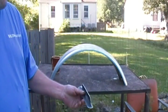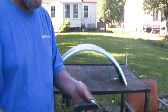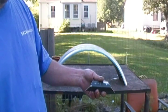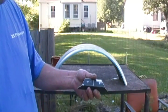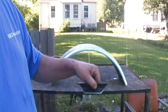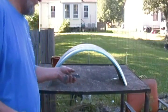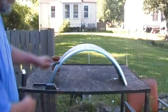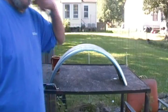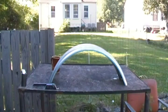This bracket will go down at the bottom of the frame with holes drilled in it to bolt to the fender. This little one will go up on the frame where the seat springs are attached — it'll hang off the bottom and hang down like that with bolts going through it. I'll drill the holes and weld the nuts on the back of the fender, and of course I'll have to cut out a relief for the chain. When I get it on there I'll figure out exactly how I want the back to look and cut it to fit.